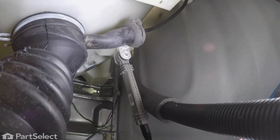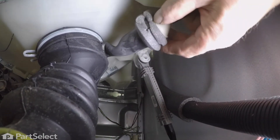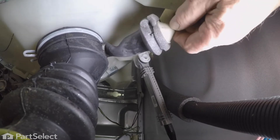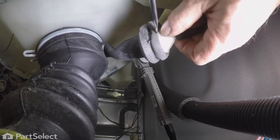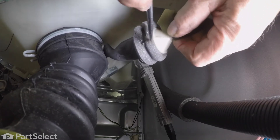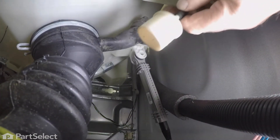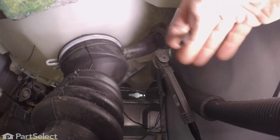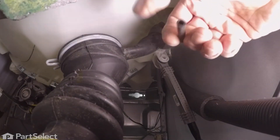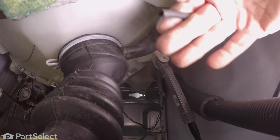Remove that, then pull that piece of foam and the hose away from the trap — it's probably on there quite snug. You may take a small flat blade screwdriver and just break that bond. If the trap is still attached to the air dome tube, you'll need to remove that and discard the old trap. Now, if the end of that trap was broken off in the hose, you'll need to get that pulled out of there first, or replace that air dome tube or hose.